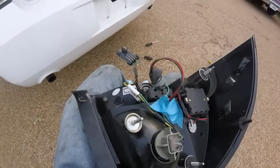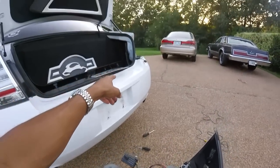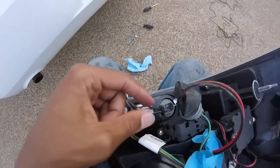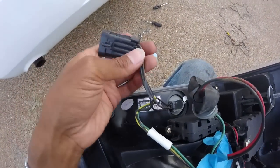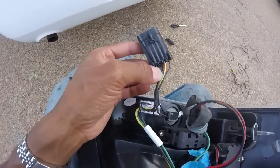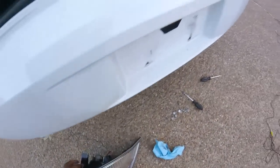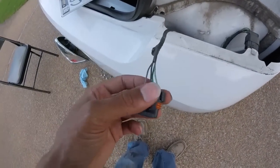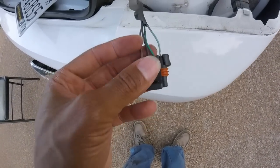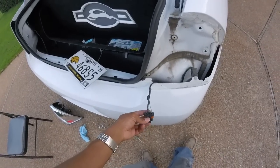To prevent from having to deal with these wires every time you change lights, I'm just going to hook it up straight to the harness. The brown wire on this set is reverse, which is all the way on the end, and ground is the second one from the left. So instead of hooking it up at the light, we're going to hook it up to the harness — reverse all the way on the right and ground the second one. That way it's wired up and you never have to worry about undoing it.